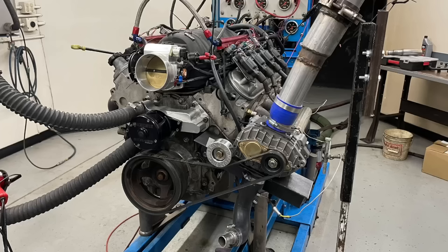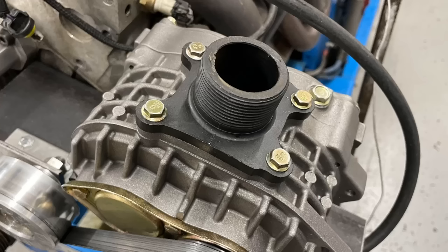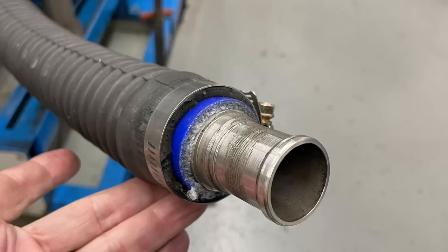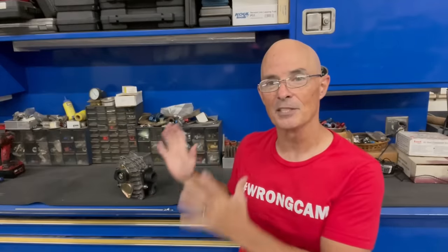Okay, guys, what did you think about this Super Richie blower dyno? Pretty awesome stuff. Using the LS motor to drive our little AMR500 supercharger, we got lots of cool data. Using our like 5 or 6 different adapter plates, we're able to run the big air turbine and neck it down to the tiny little flow orifice here we have on the inlet and the outlet side of the supercharger. We were able to get some good data. We have airflow data. We ran it open. We ran it making boost. We got charge temperature data. We also got data on how much power it takes to drive this little supercharger.